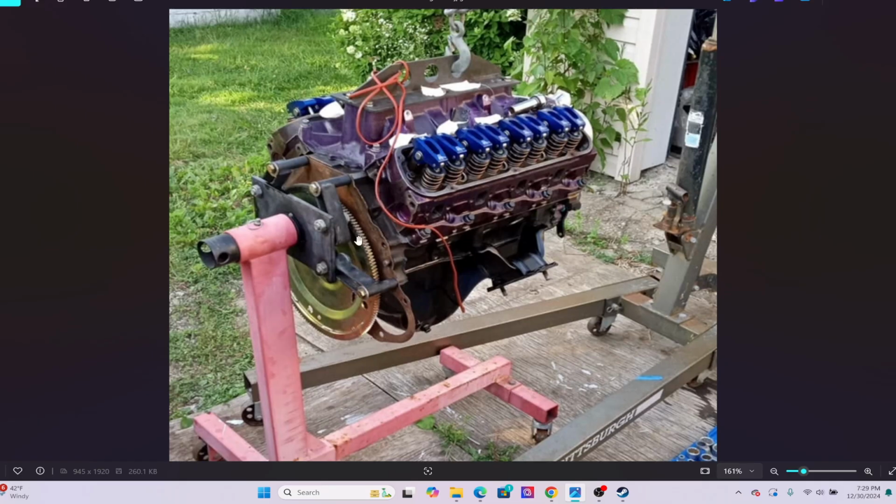I think I was worried again with this being a little bit thicker, but that is critical. With GMs, it's actually really nice and easy because they have those open bell housings, and all people do, if there's too much gap, you just add washers or something, because what it's about is the contact area between the feet of the torque converter and where it's touching here.